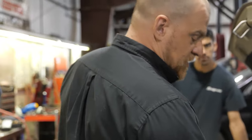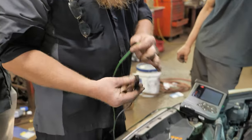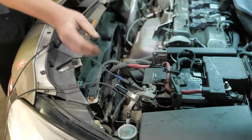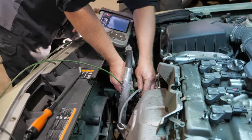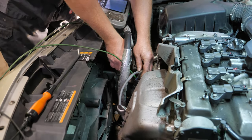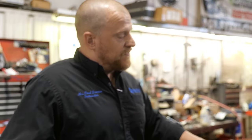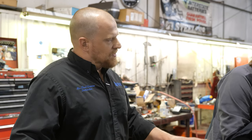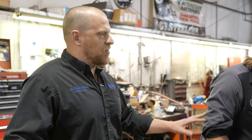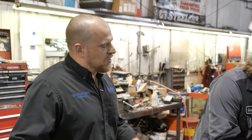Did you capture some of that data? Do you have it? I'd like to see it, just to see what I'm seeing here. I had 2.8 volts unplugged though, yes? They might be using a bias on the ground, and I've seen that. If you're seeing 2.8 volts on the sensor ground, that may be normal. Some oxygen sensors do that. Chrysler ran a 2.5 volt bias on the ground of the O2.